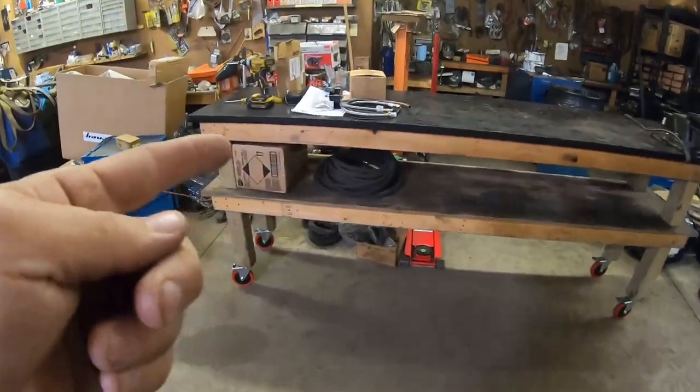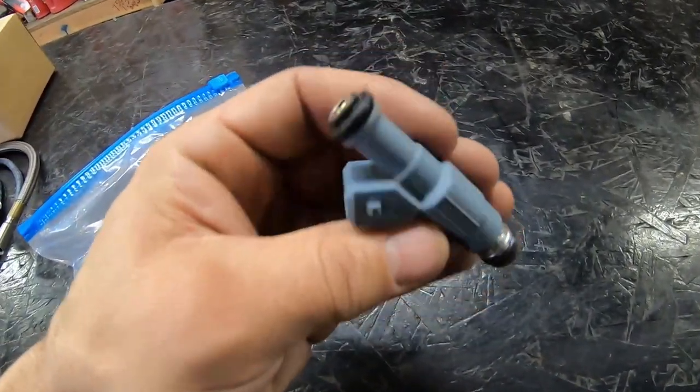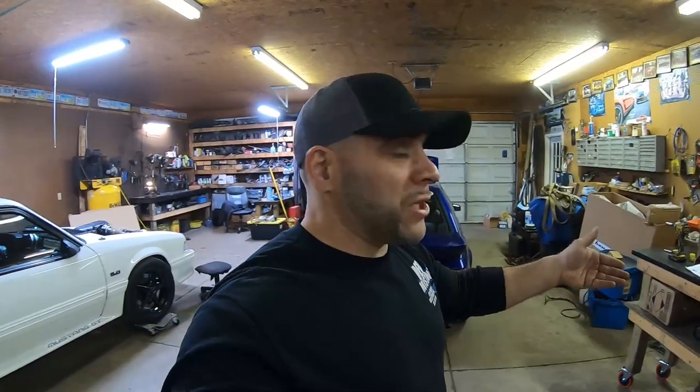This video is kind of like a roadmap of what we're going to do with this stock bottom end GT40 motor, which relates to a lot of people — even those with entry level aluminum heads, entry level intakes, B cams, and whatnot. If you have stock bottom end Fox body stuff, this is the build you need to be paying attention to. If that FMU doesn't do what we want, the next trick at the dyno is going to be to install 24 pound Ford EV6 with EV1 connector injectors. Who's to say they won't richen the mixture in our speed density DA1 computer on the 12-to-1 FMU disc? Remember, it's all about the journey with the Fox body Mustang.